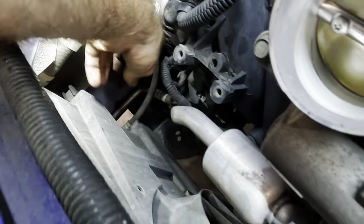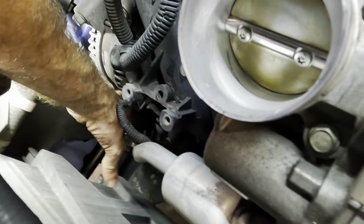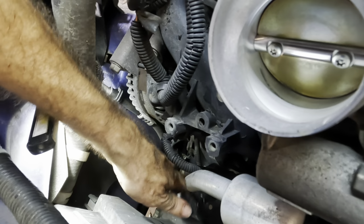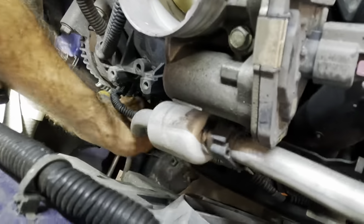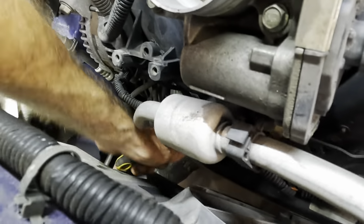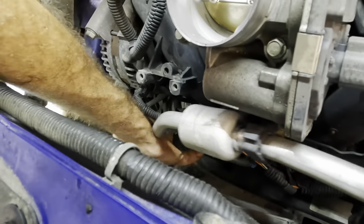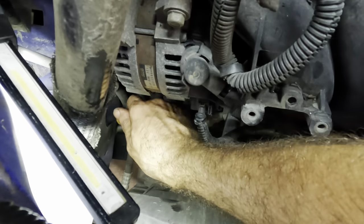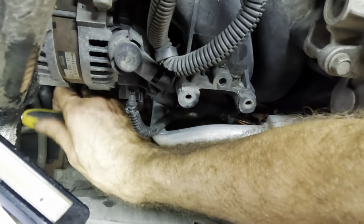I've disconnected right there. That's the high side pressure switch. And I'm reaching around the line. I know you guys can't see. I'm on the manifold bolt. I bolt this assembly to the manifold. We're just gonna pull that out and remove the entire assembly. It's been unbolted from both sides, and I've gotta take it out anyway, whether I replace it or repair it, so let's just get to it. Come out, come out. That's good, almost. Ratchet that bolt out the rest of the way, and this little guy will come free.